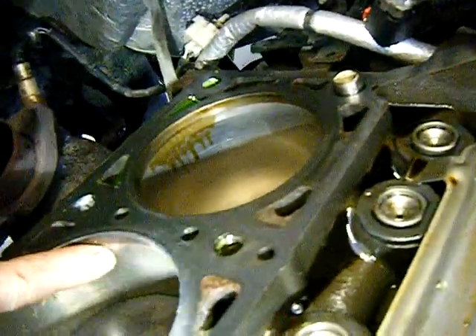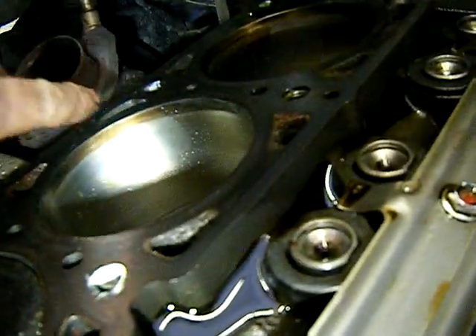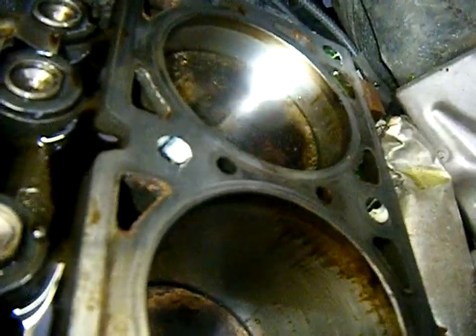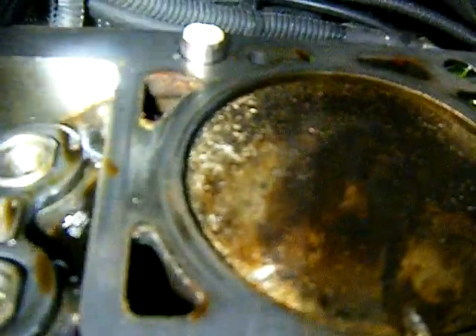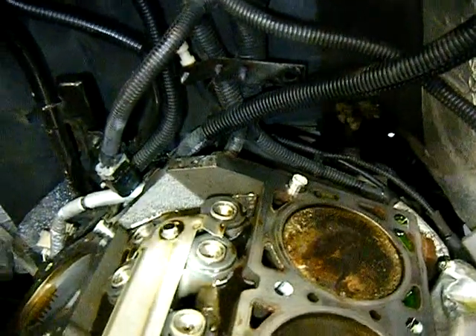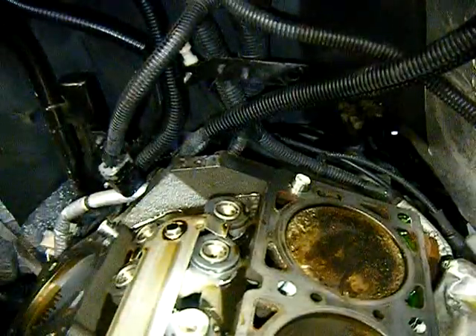This normal piston has the proper color it would have. We've got a little bit of water there from when we pulled the heads off — that's just recent. Looking at this other cylinder, you can see we're getting some metal transfer right at the top. Metal transferred from one cylinder over into the other cylinder. It does that because it's a very narrow runner on the lower plenum — it's straight across, not an upper and lower plenum — so it will transfer over to the other side.